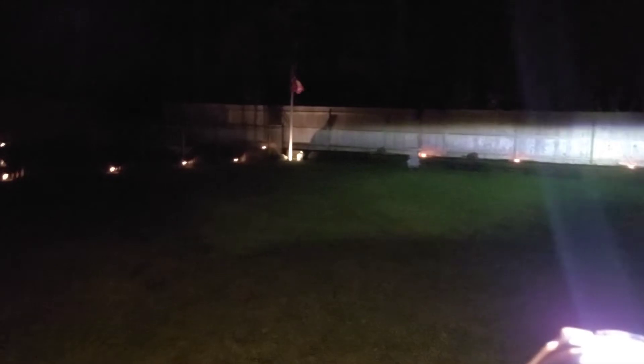Performance is very similar, but you can probably tell right away the hot spot is a little bit brighter with the LED, and the width on it is definitely better — you can see all the way out to those corners. Putting it in the same spot as the halogen, the cutoff is a little bit sloped by comparison, but it still has a really nice defined hot spot and the width goes all the way out.